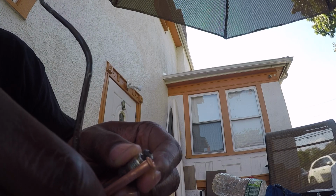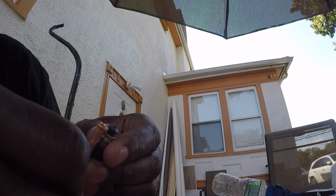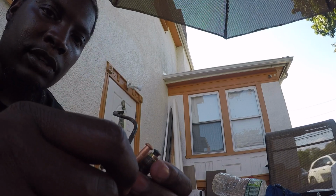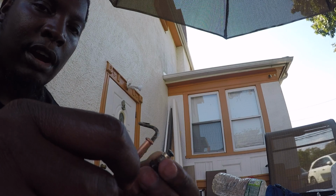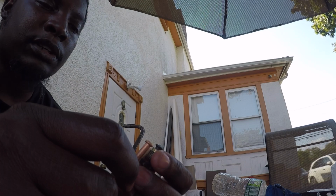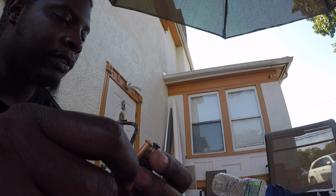If you look at the thickness, obviously it could be a little bit thinner, but this is a good side that got really flattened. It still got the bubble contour on it. This piece is a little bit higher than the other side as far as the connection, but for the most part it looks the same. So I think I'm going to attempt to use this flaring kit. Obviously before I drive the car I'm going to test it out to make sure there's no leaks in the system. So hopefully there's no leaks and everything should be fine.